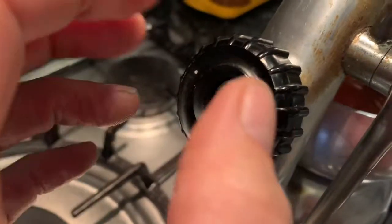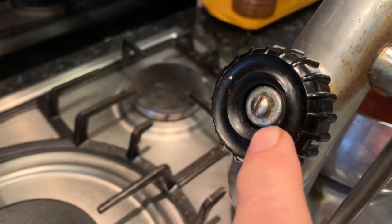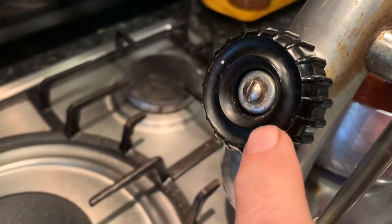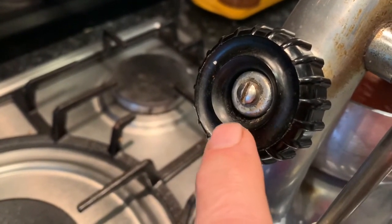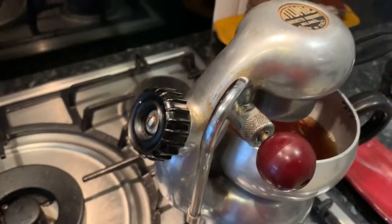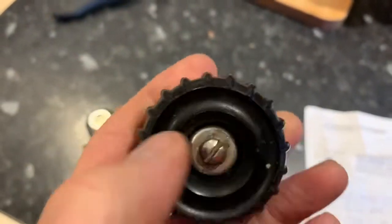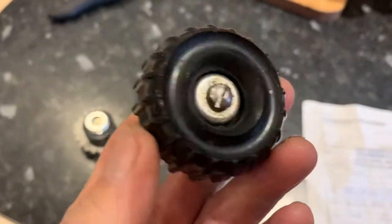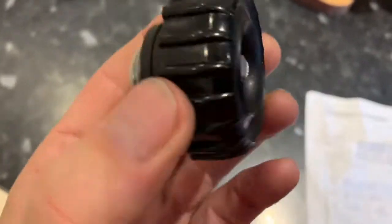Before, steam was gushing out of there. You can sometimes reduce the leak by holding the nut on the other end and tightening up the screw as much as you can. But once those seals start leaking, the leak will not improve and it's really time to replace the nut. These pressure release valves are not a serviceable item, so if your Atomic is leaking from here, don't think you can just tighten up that screw and fix the leak — it's just not that simple.